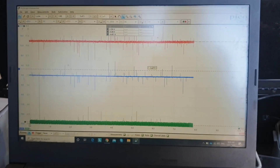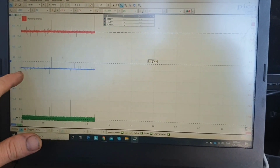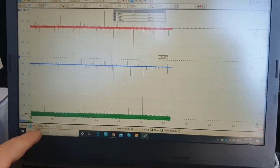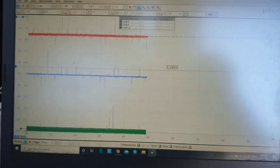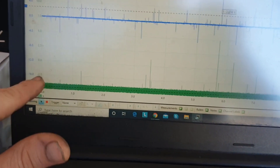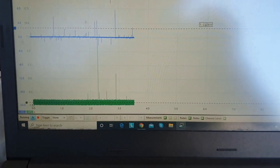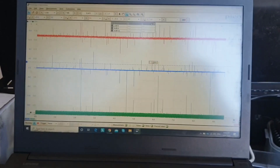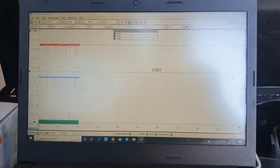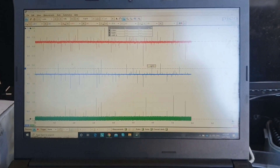Just a fixed shot so we can see where our earth used to be up at 2.5 volts, whereas now we're down close enough to zero volts for my liking. Amperage has increased - we're closer to about 4.4 amps, so four and a half amps. Anyone concerned why that is negative - I've just got my amp clamp around the wrong way, so if I flip it around it would be positive amps. Not really an issue. We've got a fix - just needed to clean up the earth. I've replaced a couple of the eyelets that were a bit burnt out, the thing was just loose, and that had caused a bit of heat and burning. Now it's all nice, clean, fixed fuel pump. Thanks guys.